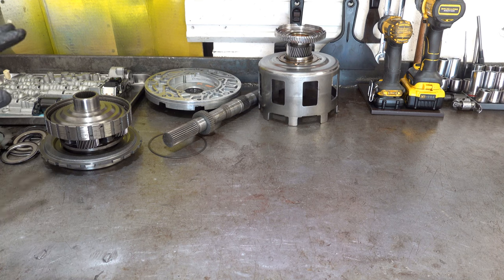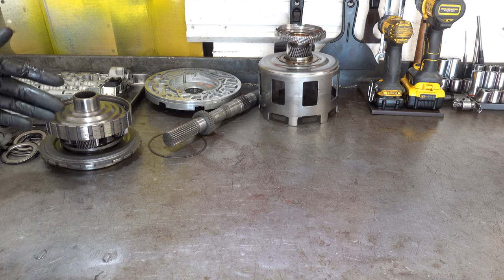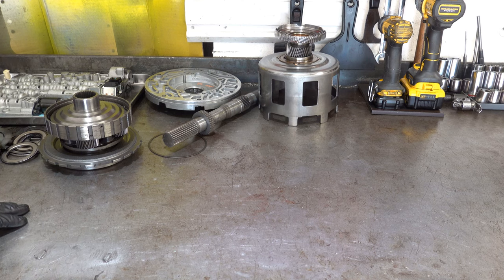But there wasn't a lot of signs of metal passing between the rotor and the slide and the two working surfaces, which is kind of surprising to me. Maybe the filter did a great job of collecting all of it, but bottom line is you had a lot of metal circulating throughout the barrel of the case.